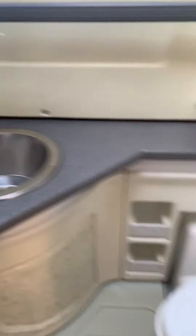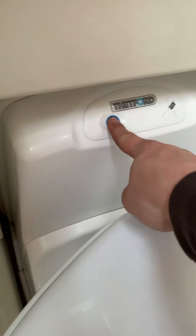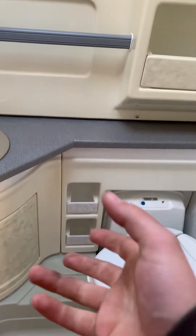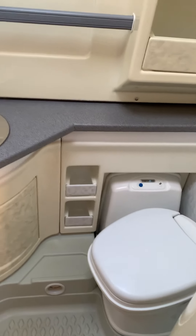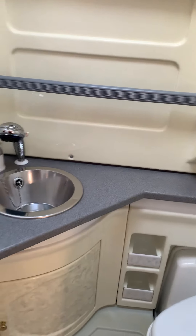So, good-sized bathroom. You've got a button to use your flush there — it's literally a case of pushing that button. The pump runs and then it can splash when you open it up, so just close that up. If you find you're on the outside of the van one day and you're trying to pull the cassette out and it won't come any further than two or three inches, you'll find that you've left the flap open. Just come in here and close the flap up, then go back outside and it will come out straight away. All of this has all been checked — no leaks or anything like that.